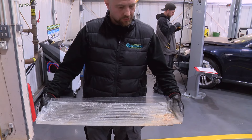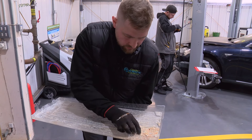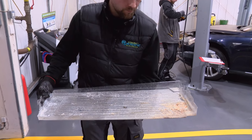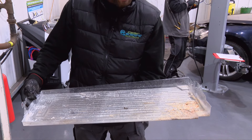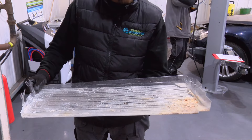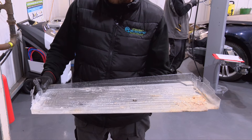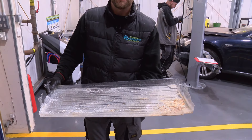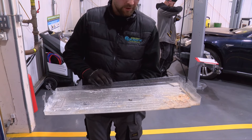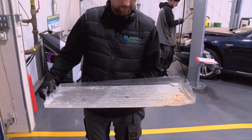This is one of the plastic housings that lives around one of the Tesla modules, and you can see it is absolutely full of corrosion — parts of the cells and bus bars inside starting to corrode and break up. This was from a very wet battery, so this module needed to be dismantled and disposed of correctly. We've kept it just to show how bad they can get. Typically they're not as bad as this — this is a very bad example — but the water gets trapped and has nowhere to go, so it sits in the bottom and just starts eating the module alive.